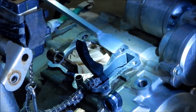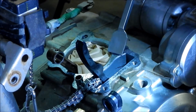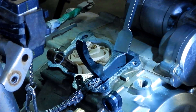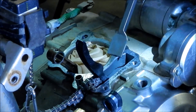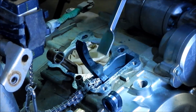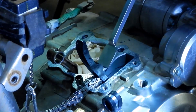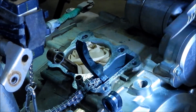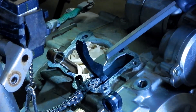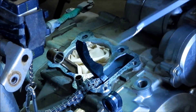This surface is not super critical in terms of sealing because it doesn't really hold any compression in. The one that holds all the compression in is the head gasket — that's the important one, the one that will really affect your bike if it's blown or anything. This base gasket just keeps the oil out. I guess if this went bad, you'd get a whole lot of oil pissing out all over the place.